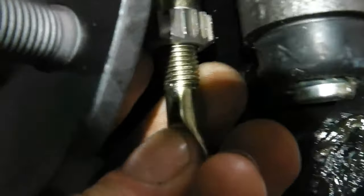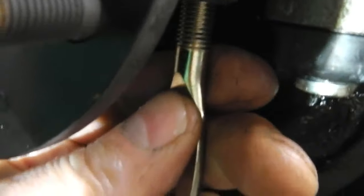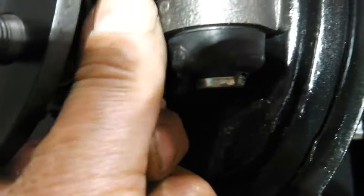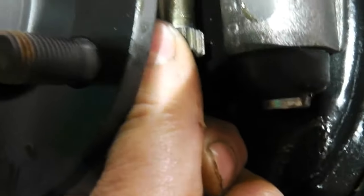It's difficult to do it with one hand because I'm holding the camera, but I'm trying to turn. I might get this on my thumb now and you might hear the click just there. So can you hear that? I'm turning that, and that then pushes the threads outwards, so that's effectively tightening it up, and that's what the lever does. If the lever's not working, you often find people will manually turn this in the car, you know, with a drum off, because the lever system will have seized and stopped working.